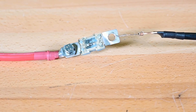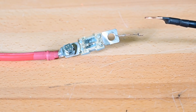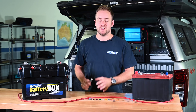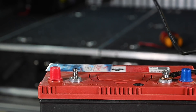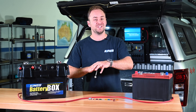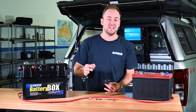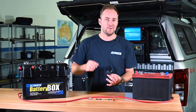Here's an extreme example: I'm putting a 300 amp fuse on this thin wire here and short circuiting it onto a battery. Short circuiting this battery means it's able to put out 3000 amps of current. So be careful whenever you're tightening battery terminals — bridge the terminals and you'll definitely see some sparks. Also be aware of any jewelry, whether it's rings, watches, bracelets or necklaces, because if they arc out, it'll hurt. And while you're hooking everything in your dual battery system together, take the fuses out so nothing's live while you're working.